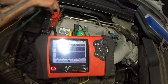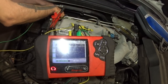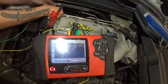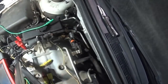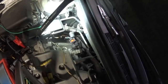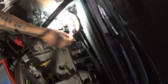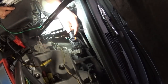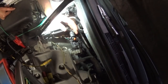What I'm going to do is take this off and unplug my solenoid. I just want to go to the connector here and give a gentle pull on it — and here's your issue. We have a broken wire in the insulation at this pigtail. So putting a new solenoid in here is not going to fix this car. I know these fail a lot on GMs — it's a high failure rate — but that's not the problem on this one.